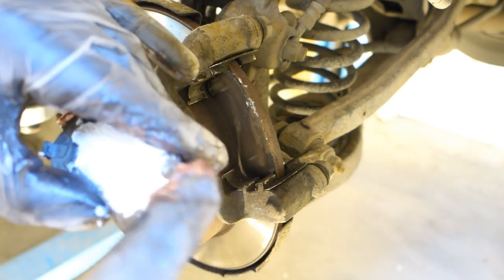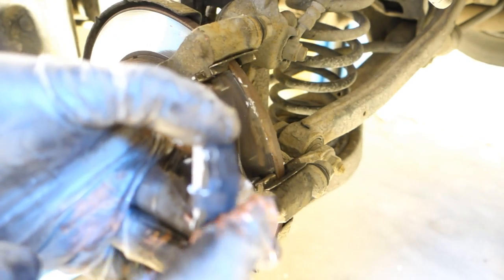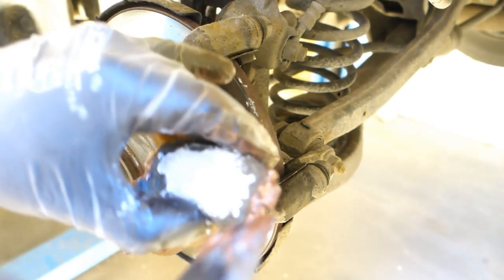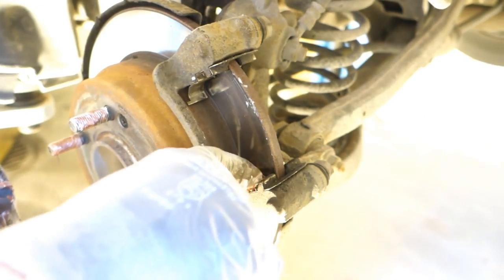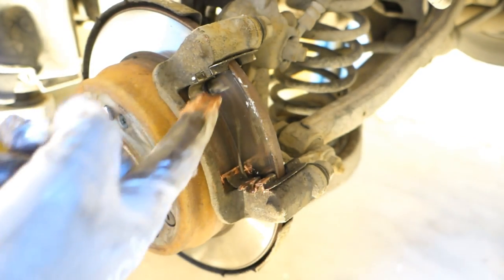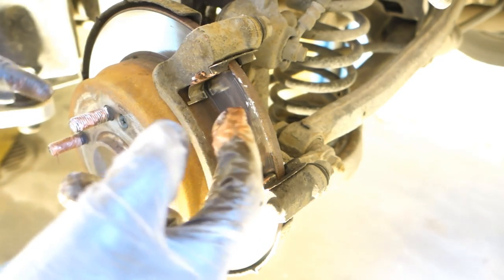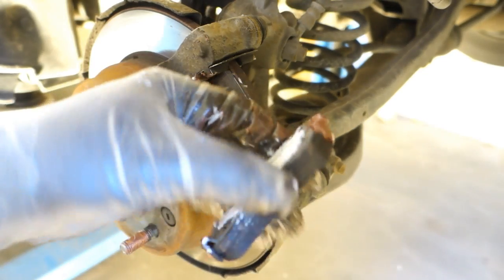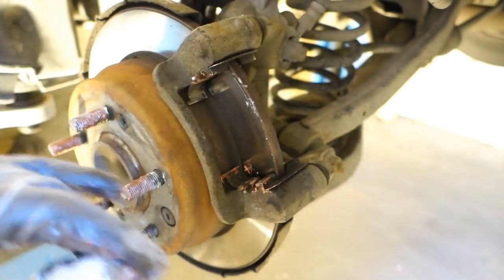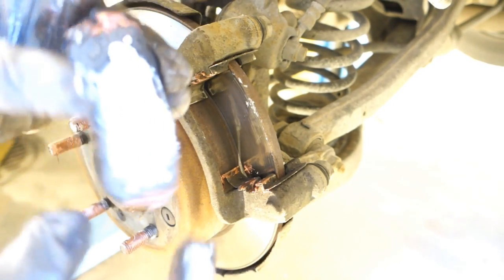I added this copper paste in here. Now I take a little bit away and then in that area. It is like two points. Here is copper paste and here. And then these areas in here, I can insert a little bit of this lubricant, but be careful that we don't get this copper paste on the brake disc. It must be clean. But now this pad is ready for installation, and actually I can install that quite soon.